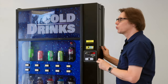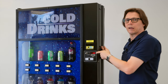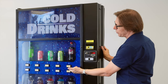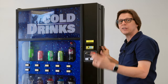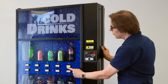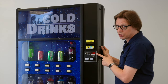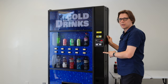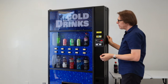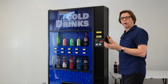I'm going to need to increase that price, so I press selection button 3 to enter. The screen will blink and I'm presented with the current price. I can increase this price by pressing selection button 1 — it increases in five-cent increments. If I press selection button 2 it will decrease in five-cent increments. I press selection button 1 and keep going until I get to $1.25. If I press and hold it will jump very rapidly and I may overshoot — I've actually overshot to $1.30, so I come back down to $1.25. Now I need to save that price by pressing and holding selection button 3 for a count of one, two, three, then let go. The price will be saved.